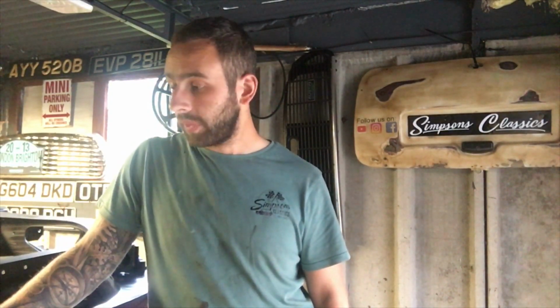So I left you with the 89 build, and the subframe and floor weren't quite marrying together properly. A number of reasons that could have been: poor bracing, it could have been the shell moving a bit on that jig, it could have been anything, it could be fault down to the panels. I wouldn't put the fault at the panels because everyone else has used Heritage panels, they fit pretty well. So I personally wasn't going there first.